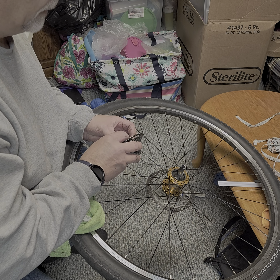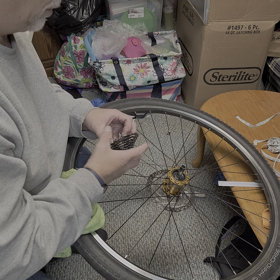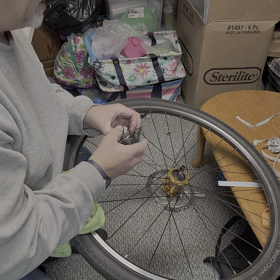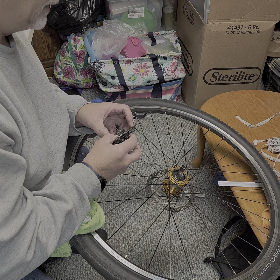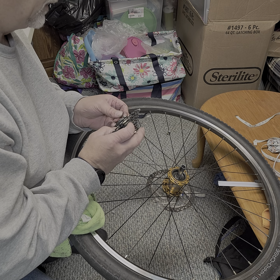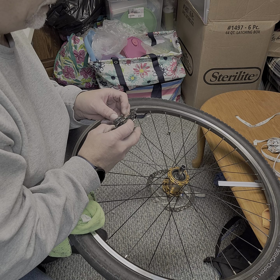Hold down the pawls. There are six of them. Normal wheels have three, this has six. And a lot of people get these wheels and they complain that they're noisy, and they are quite noisy, but they're noisy because there's so many ratcheting pawls.